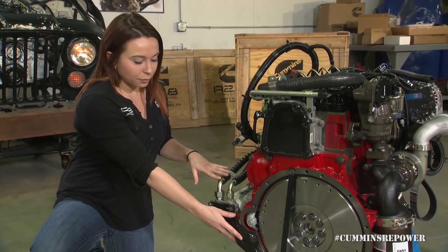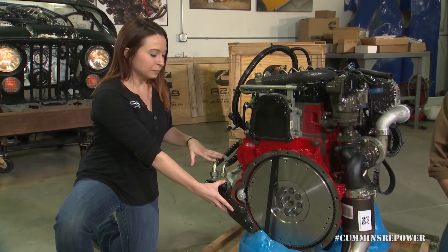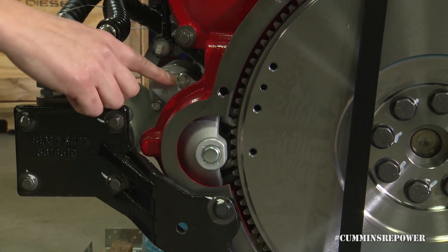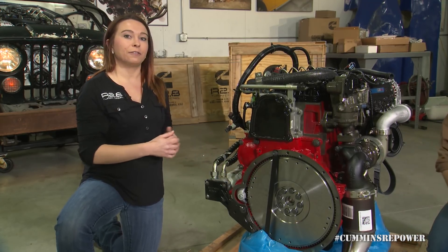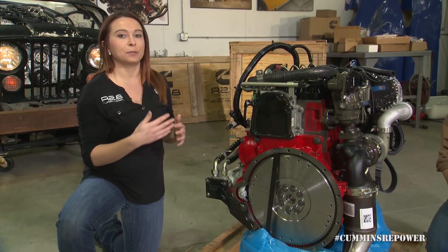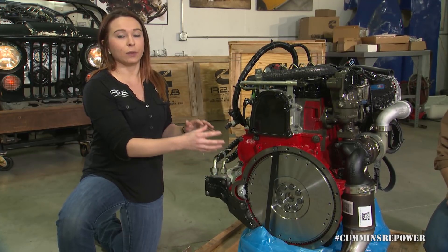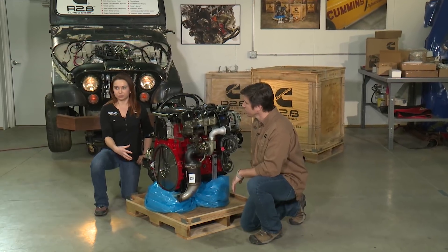You'll have removed the bracket for your oil filter — that'll be out of the way, mounted on the chassis — and you'll want to take into consideration your starter, which is mounted on your flywheel housing and interacts directly with your flywheel. Definitely look for a SEMA member who has engineered transmission adapters and flywheel adaptation that will take all this into account and will reduce overhung mass on your flywheel and crankshaft to reduce any potential for failure.